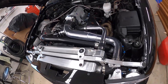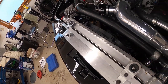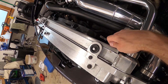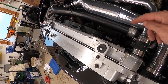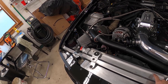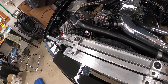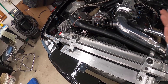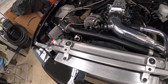I got the shroud and fan mocked up and mounted. I got the hole cut out, bolted the fan to the shroud, and drilled a couple of mounting holes for the top. I really don't want to pull the radiator, so I'm just going to zip tie the bottom — the top mounting should hold the majority of the weight. I'm also waiting for some gasketing edging to go all the way around. I have enough room to put a small thin gasket in there, hopefully to help with vibration.